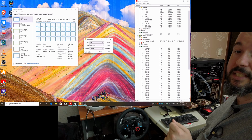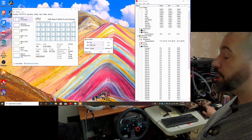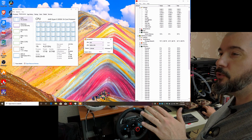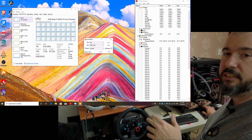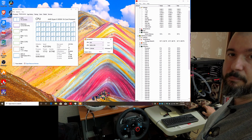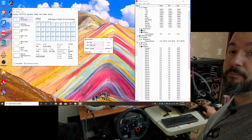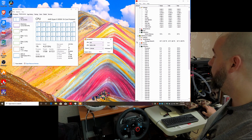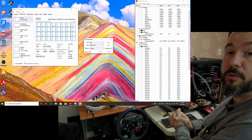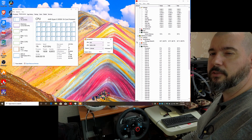The last time I ran that test, it got to about 65, 70%, and then the machine just rebooted. If I wanted to, I could probably bump the V-core back up to 1.2875, I think is the next step up, and probably get it to be stable. But I don't think anything I'm doing on here is going to cause it to hit that heavily. But if it does, I'll be sure to let you guys know. Or just to be sure to fix my voltages. Anyway, so now I'm gonna get down to running some benchmarks on this, and I'll give you guys the sweet, sweet results.